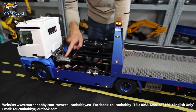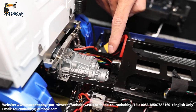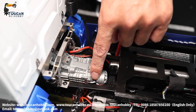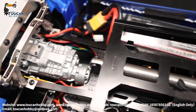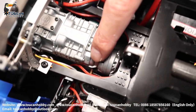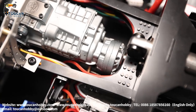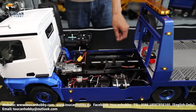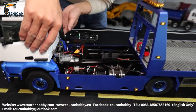Come to see here - this is the transmission gearbox with the transfer case. Let it down there and we will see - you see the wires there. That one is the lock. I will move it so you can see. That's the lock for the front axle and rear axle to be turning together or not.